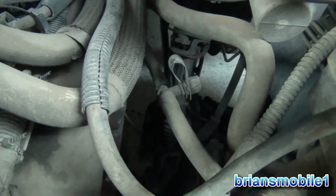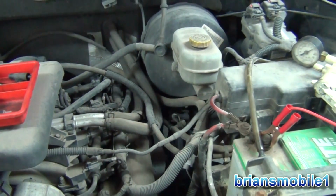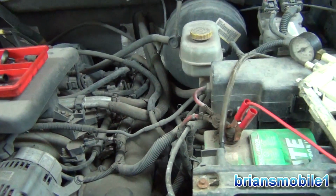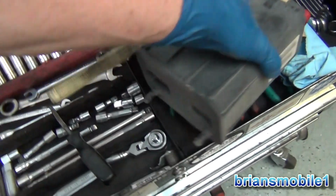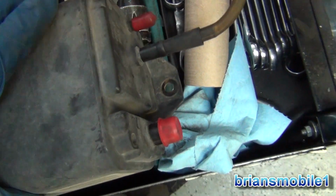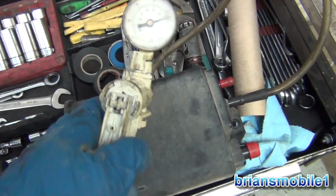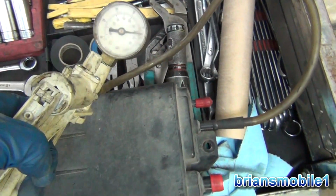So if that wasn't the 442, it was the 455. Maybe, I think the 442's been there a while, and the 455 is just a recent development. So I pulled the Evap canister out. There's just a couple of nubs on the back side and a 13mm nut on this side. No big deal. What is a big deal is getting this thing to pump down. I had to cap it hard. I had my fingers over it and that worked okay, but for the video I got to have a hand free, so I did that.